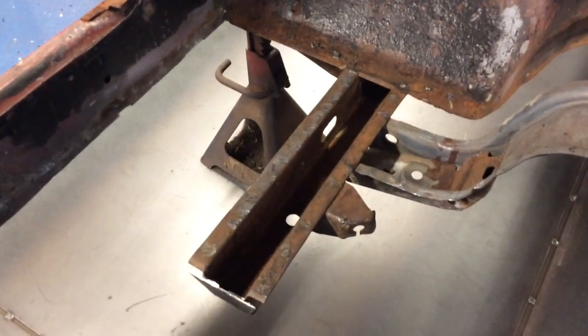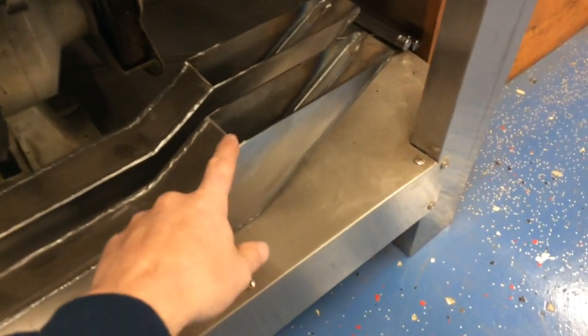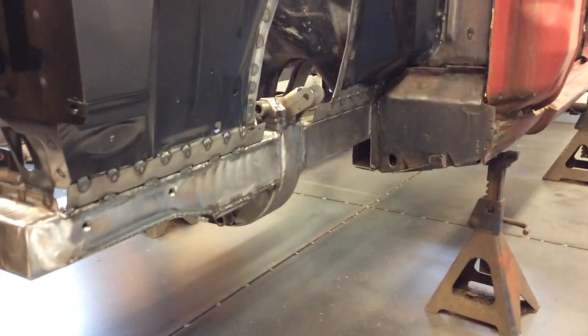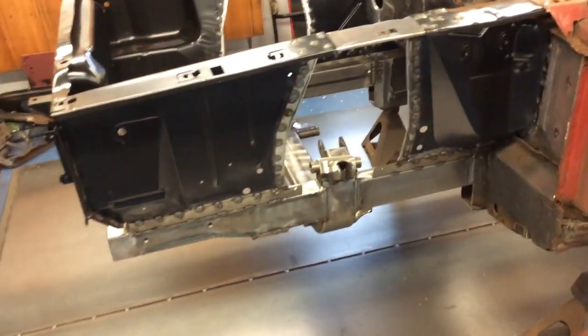Pretty much just need to clean up a couple things. To prep for that floor pan, I've got to change out the floor supports and do both toe boards — that little bit that I showed. Then the floor pan can go in. These are the new floor supports they want you to use. You can see this end meets up to the bottom of the rails of the new kit that I welded in. They go in that slot — you cut out the whole bottom of the original floor support, slide this one up in place, and weld it all around. Weld it to the floor pan, weld it to the original frame, weld it to that new frame in front so it gets tied into everything. That's where we're at today and that's what we're working on.